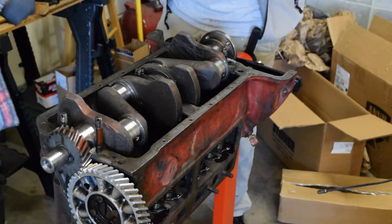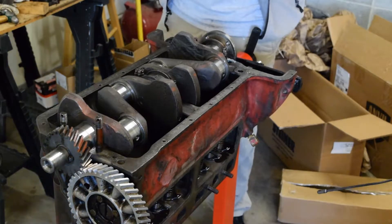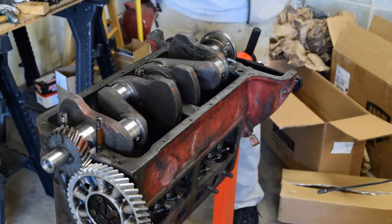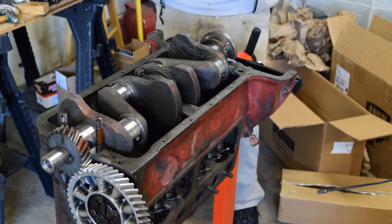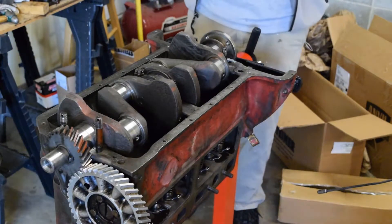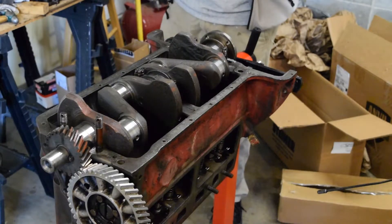So these need to be torqued down. We're going to start out with our torque wrench — we're going to do 45 foot-pounds just to start out, because we don't want to overdo it. The spec is 75 to 80 to 85 foot-pounds. We're going to put you on pause and get the torque wrench.